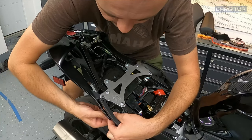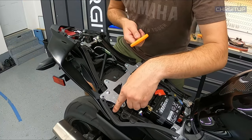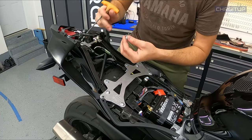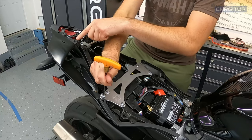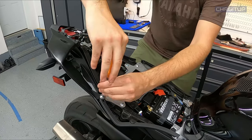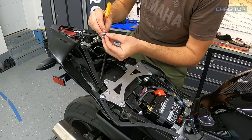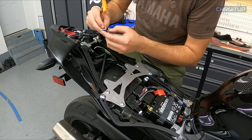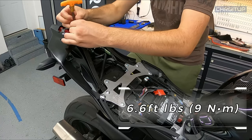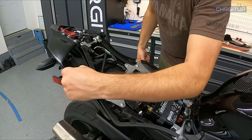We're going to take our push pins. We're going to put this guy in first — the one that's underneath. Now that we have our one push pin right there from underneath, we're going to grab the silver bolt. This is actually shorter than the one that goes in here, so don't get those mixed up. This one also has those little metal rings, whereas this one does not. So this goes in like so. Now we're going to grab our two longer bolts — these are size four allen bolts as well. These ones remember have those little washers to fall into place. These don't have to be tightened so tight, just a nice gentle snug. And there you go, that flare is back on.